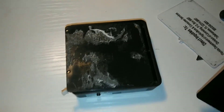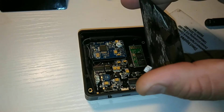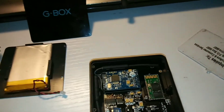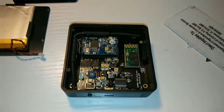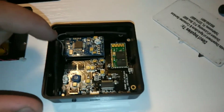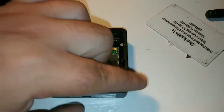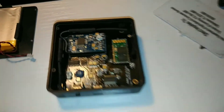Like I said, there were four screws. You'll have access to those. Once you pull those out, you'll get to the battery part. Make sure you unplug the battery from the board right there. You can flip this over. Then there are three screws holding on the transmitter board here, and two antennas. The antennas just pop out. There's a screw here, a screw here, and a screw right up here. As soon as you pull those out, this whole unit can come out.